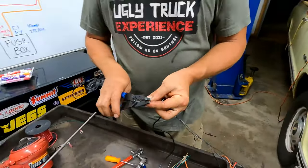Alright, so we do have an orange wire. The orange wire is the power coming into the ALDL connector. The only reason you run power to the ALDL connector is it's just for your scan tool. There's nothing going on that you need power for. It's a nice place to use when you're under a dash and you need some power, just to steal some for a second while you're looking at something. But otherwise, it does not need power except to power up the scan tool. And that's what that power is for, and that's why it's hot at all times.